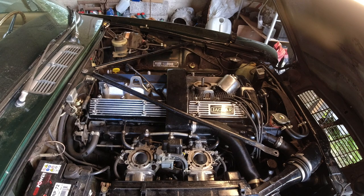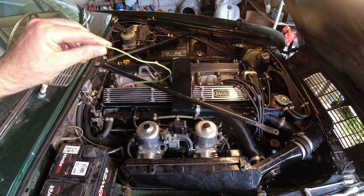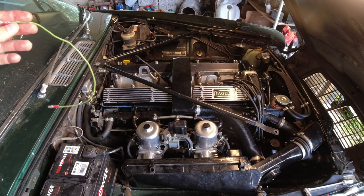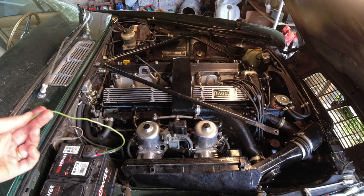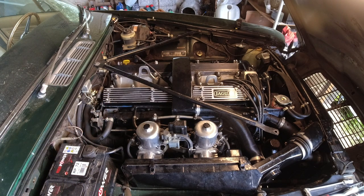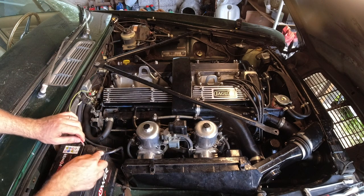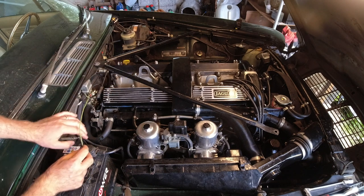Tops of the carbs are back on. I've depressurized the coolant system and grabbed a little jumper cable — I keep one of these in all my cars. It's great if a fuel pump relay goes bad or something happens with your inhibitor switch; you can jump things, which is always handy. This one is the main cable going down to the starter. Double-checking that we are in park — yes we are. I'll connect that and jump it off the positive on the battery. Keep an eye here if we see any coolant shoot out.